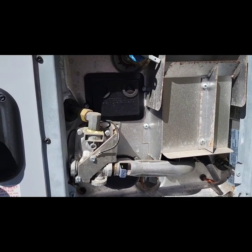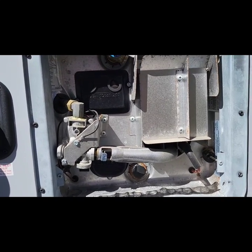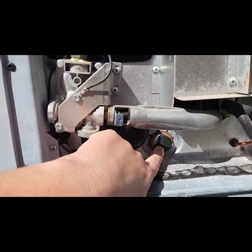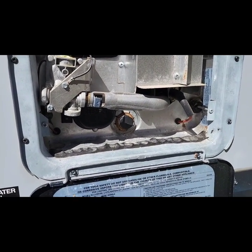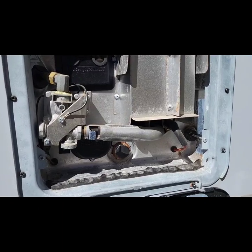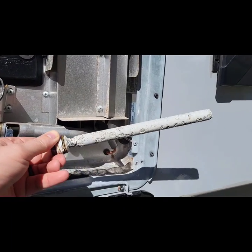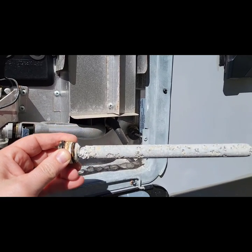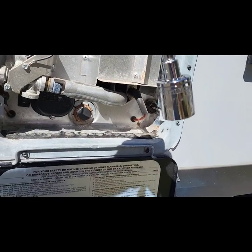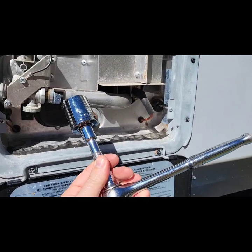Last water-related item: your water heater. Here are your actual resets for your water heater. If you leave it on without any water in it, it will trip those fuses so you don't ruin your hot water heater. Here's your anode rod — I've just put a new one in. They're cheap. What the anode rod does is stop the water from attacking the inside of your tank — it attacks the rod instead of the tank. They're very useful and necessary. To get it in and out, you're going to need a one-and-one-sixteenth socket. Go ahead and have one of those on hand.